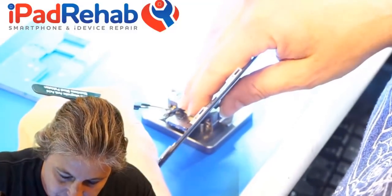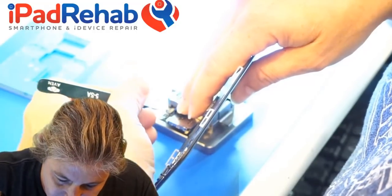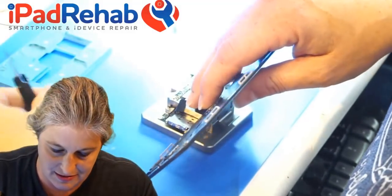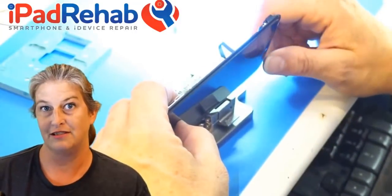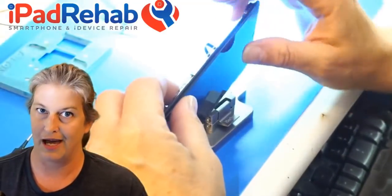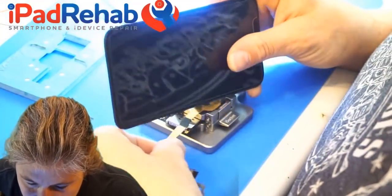What I really want to get to today is a test to see whether we can mix and match an iPhone 10 main board with a different iPhone 10 RF or baseband board. Can we mismatch the top and bottom boards and then kind of update using the iOS 12 beta 1 that ignores baseband, and get one to boot? A lot of times the iPhone 10 I was just working on had a VCC main short in the RF board, not in the main board, so I'm hoping I could put that probably-working main board with a different working bottom board.